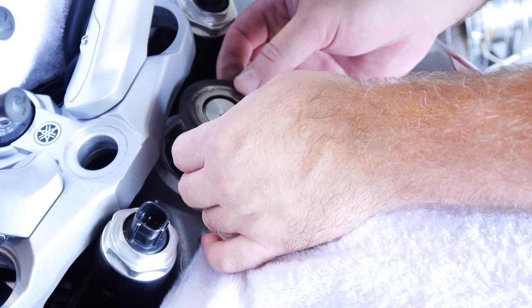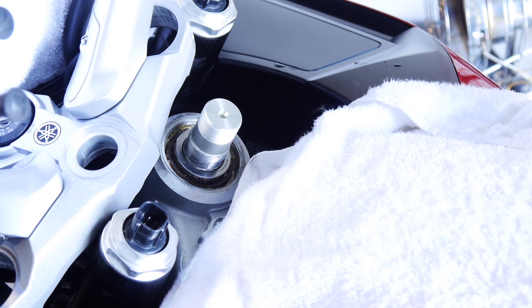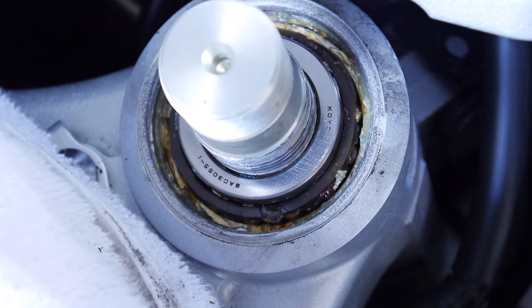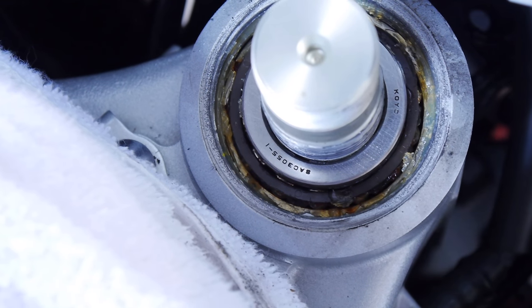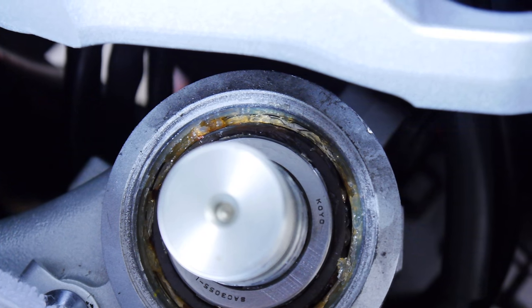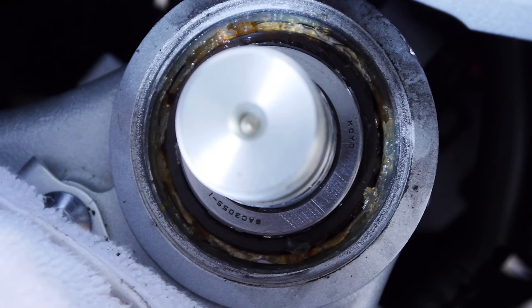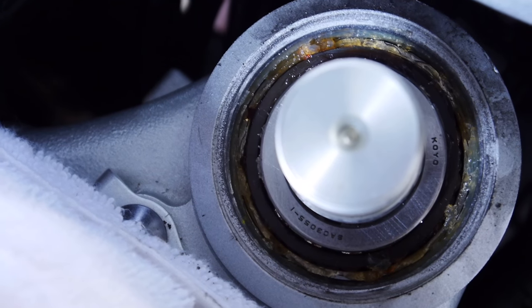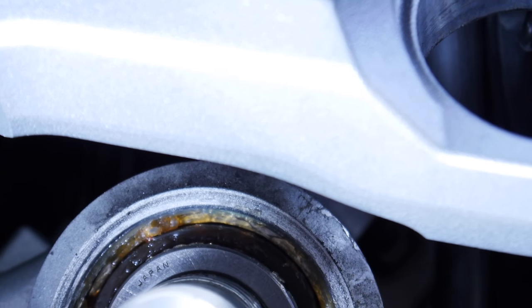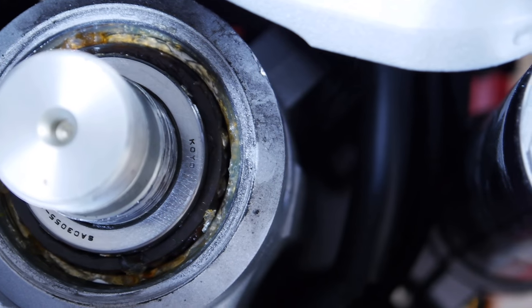Gently take off this plate seal — we're going to be cleaning all that old grease off it. Here's a look at a never-touched factory bearing at just over 16,000 miles. It's not bad — no signs of water intrusion. What you're looking for is obvious signs of rust, or grease that's gone really milky white. I'm seeing it looks a gelatinous yellow color, which is about normal for this kind of grease.